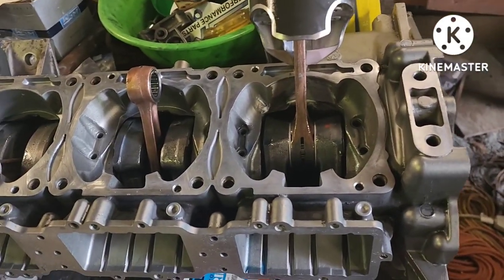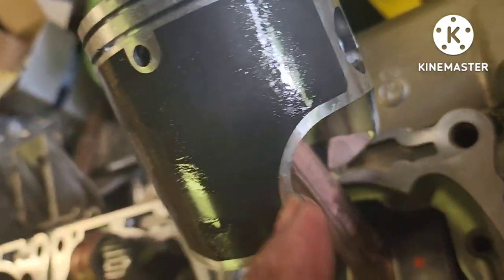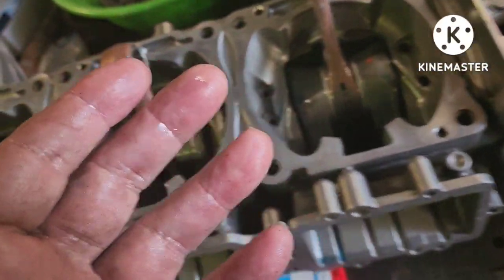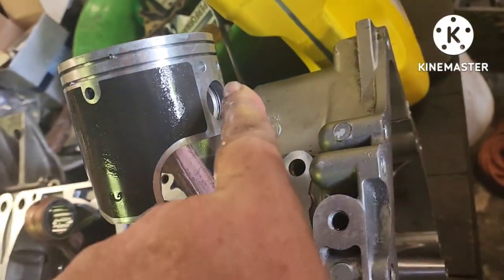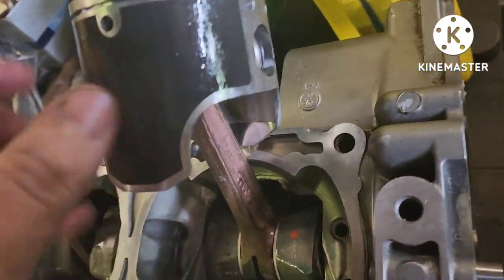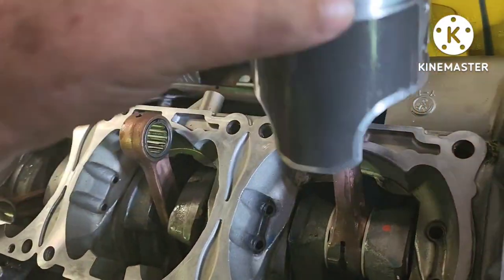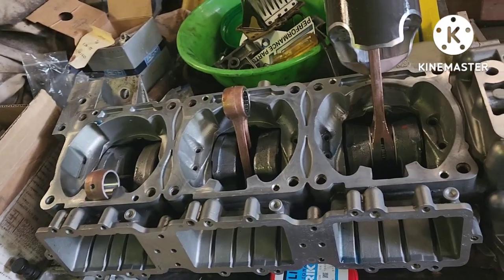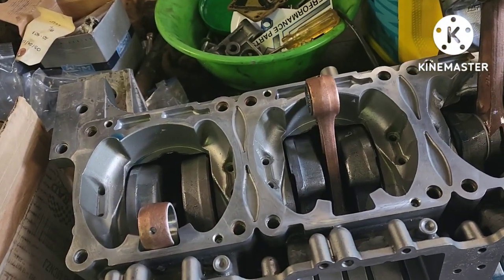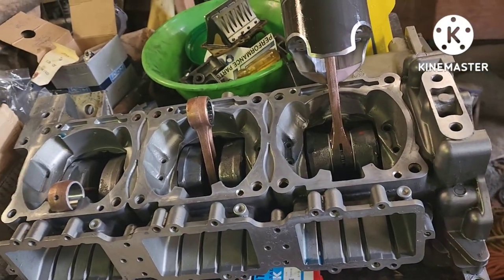This one's on. I like to double-check with a light shining on both sides when I'm done to make sure my circlips are fully seated, because you can get them on there and they're not fully seated in the groove of the piston — the groove holds the wrist pin. Two more to do and that step is done. Two-stroke oil is your friend here; use it and lube everything. It's going to smoke like crazy when you fire it up, but that's part of the fun.